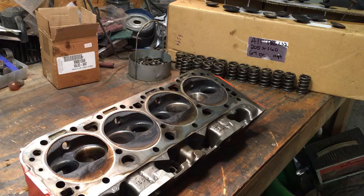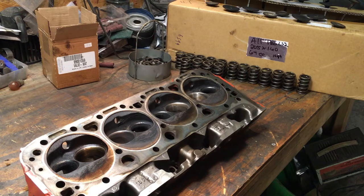Basically these are going on the small block Chevy I'm overhauling to sell. Like I said in all my previous videos, I won't sell someone something I wouldn't run on my own vehicle. So during the overhaul of this 350 — which only has 3,000 miles or less on it — I want to go through it, make sure all the bearings still look good, and throw a fresh set of rings in it to make sure there's absolutely no problems for the end user.